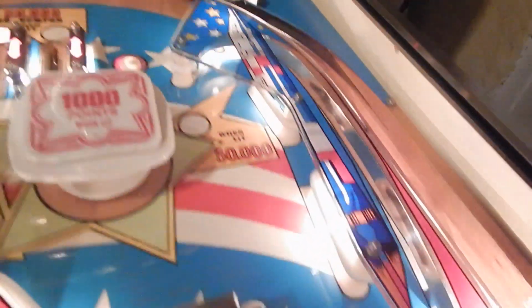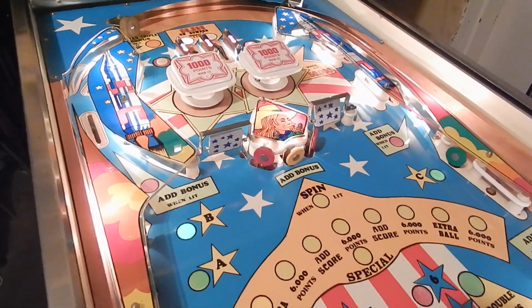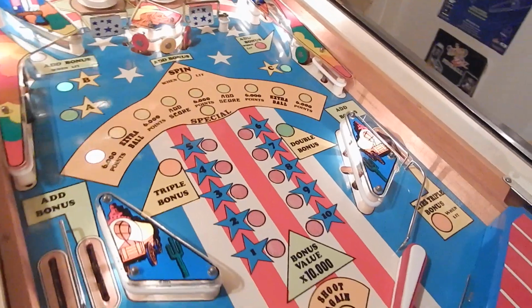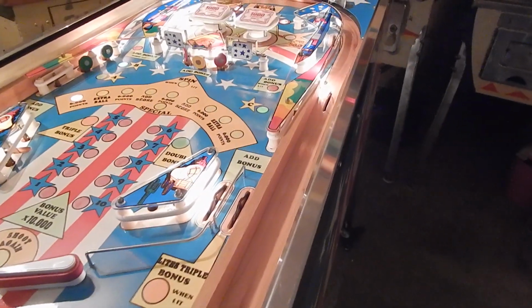And these switches were hanging, so on one I nailed through, holding the switch underneath the side, and I used some really thin fuse wire to hold it on, and that worked. So these switches are all screwed back in. Playmatics are notorious for switches falling out because they're just riveted into a metal base, but it seems like it separates, so quite a few, like 4 of them. But really no problem. I fixed them before and quickly.